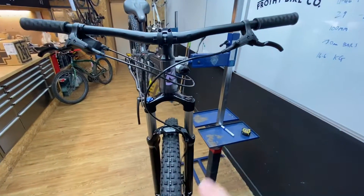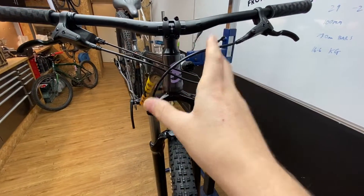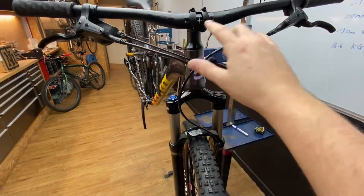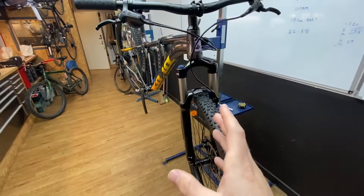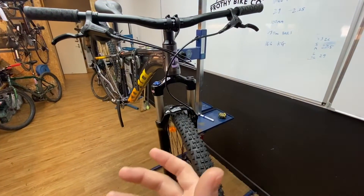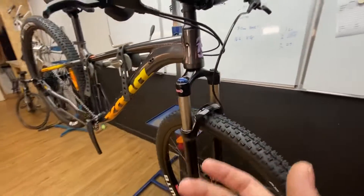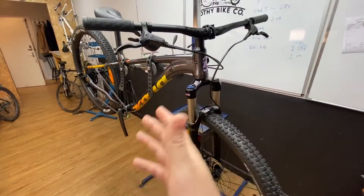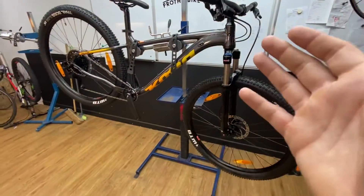When you buy this bike out of the box, it's a European bike so the brakes are the wrong way around. If you buy it from a reputable online supplier or face to face from your local bike shop, they will switch the brakes over for you. The barbs need to be switched over and they will need to be bled as well to make sure the brakes are running fine. If you buy it in a box from an online supplier and they've not switched the brakes over, you don't really have a warranty claim on it — they've just chosen not to switch it to UK standard. But you can always just phone up and ask. Some online retailers do take it out of the box, check the gears, brakes, and tyres, then re-box it and send it off to you.